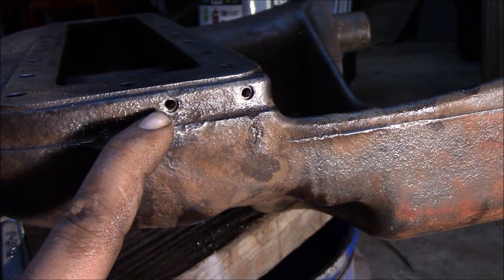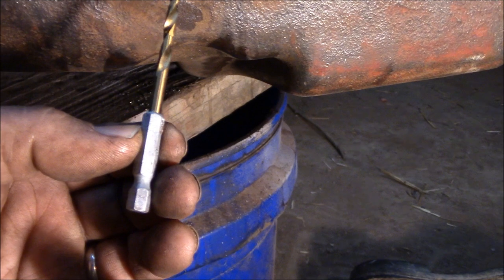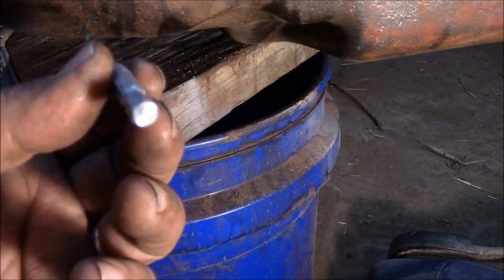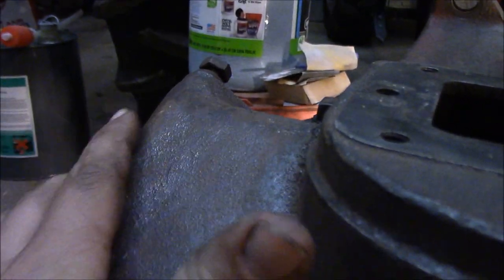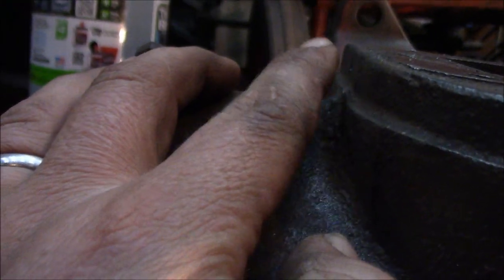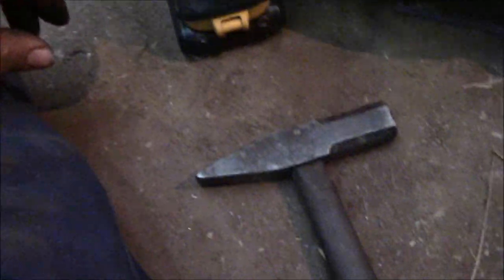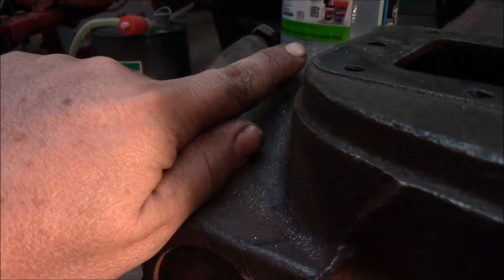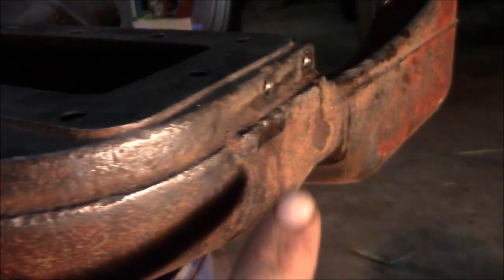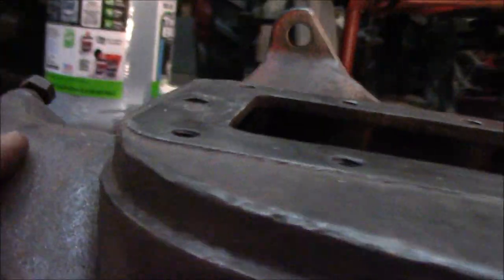I couldn't get them out, so I drilled them out, and then got a 13/64 drill bit. Because this part of the steering system here interferes with getting in here and drilling in these holes. So you have to use some type of extension. I've got another extension here - a little bit longer - and that gets me past that hump right there where I can get a straight line shot into that hole, because there's two holes. Just like on this side, there's two. So it's very tight, and the chuck of the drill hits, so there's really no way around that - you have to get some type of extension.